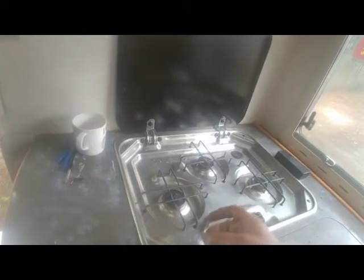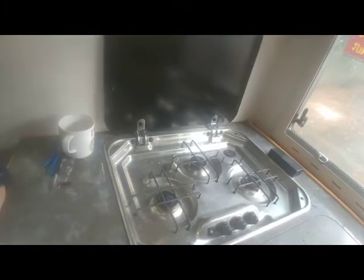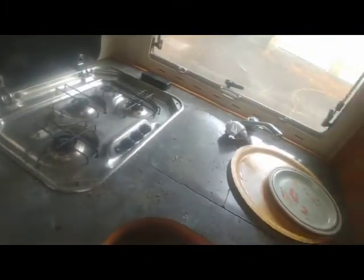The reason why I say go to the hobs first is, one, it's easy to light, and two, the fridge takes less gas than these. This is the most draw power of them all. So the hobs take a lot more gas than the others. I've always found this a bit confusing here, but clearly, yeah, that's the gas taps. That's the saucepan one.